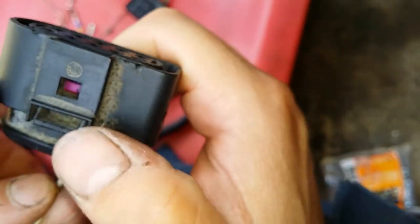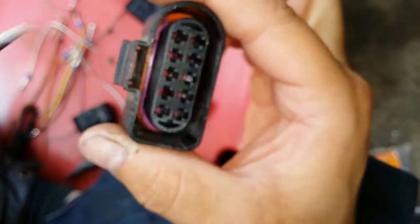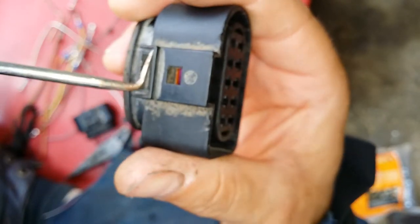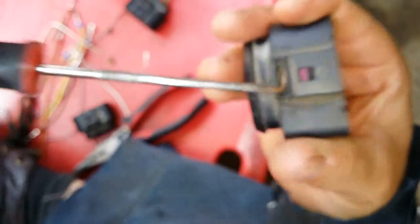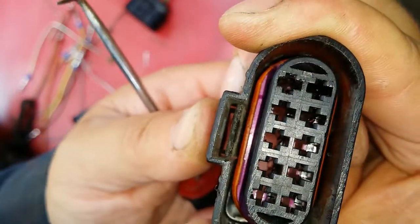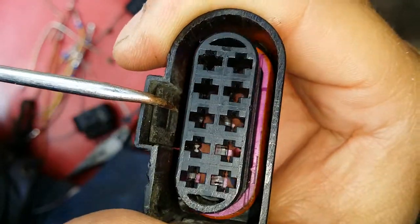The reason why you spread them is that if you don't and you plug the connector into the other connector, it would actually push the wire out from the pigtail. So if you see one with the rubber pushed out, that's not good — you have to pull it back out. To disconnect the connector, a lot of people have asked about this — put a flat screwdriver right in there and pry down. When you pry down, it actually opens and releases from the other pigtail.